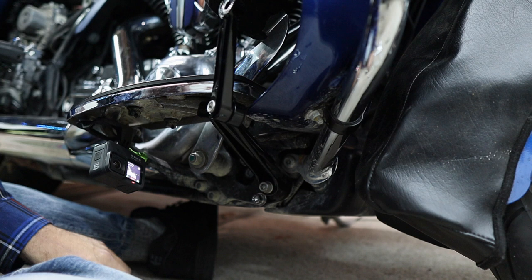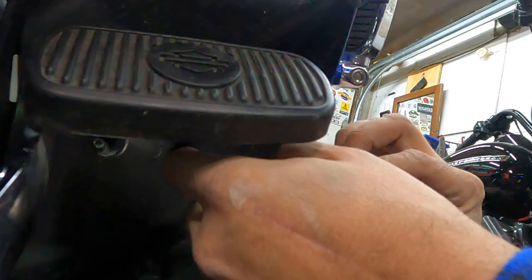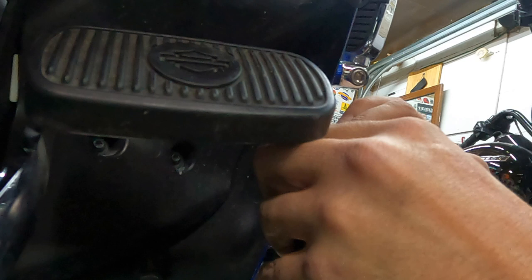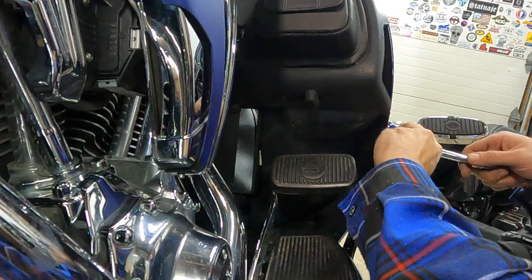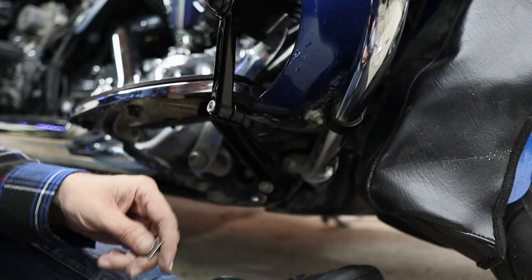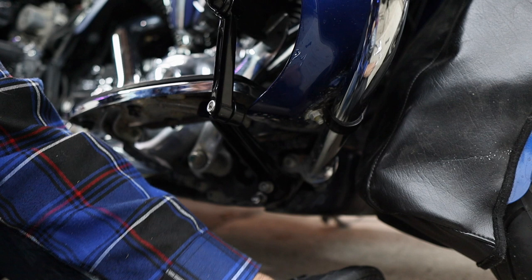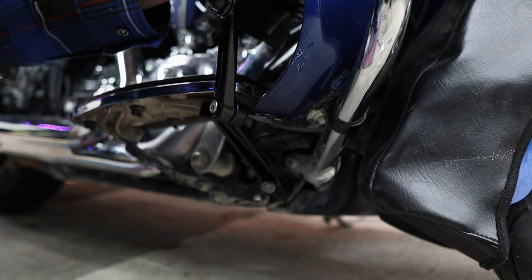For the next part is our clevis. We're going to take the shortest bolt they sent us and that's going to go in from the back side here. These are completely adjustable to suit how you want them. I do have foot pegs coming from Ciro but they were on back order, so I'm just going to use one I had from my old highway pegs so we can get things lined up. If you've ever used these D clips or whatever they're called, you know it can be a pain to get everything lined up, but not impossible.